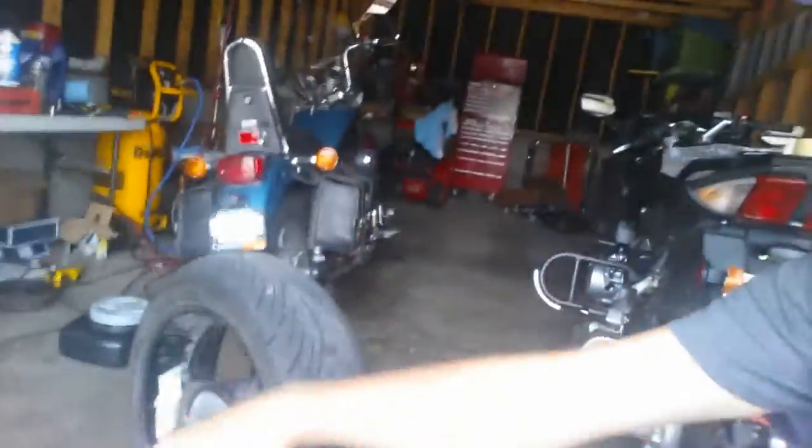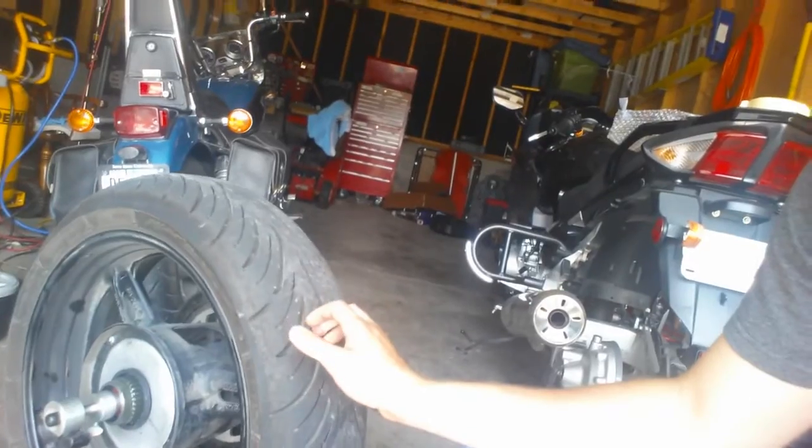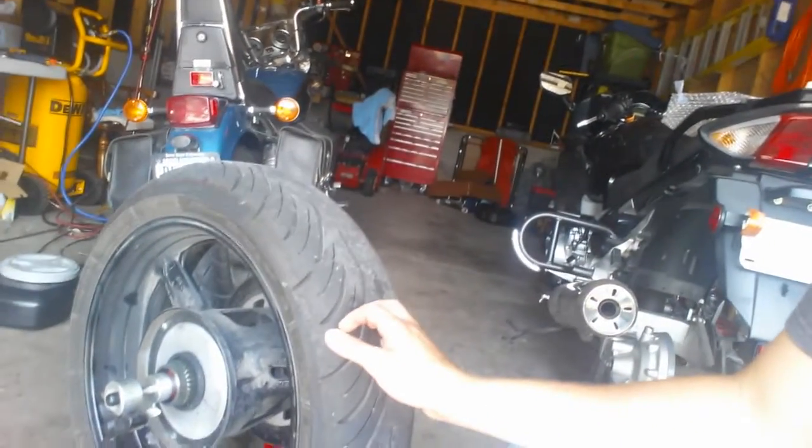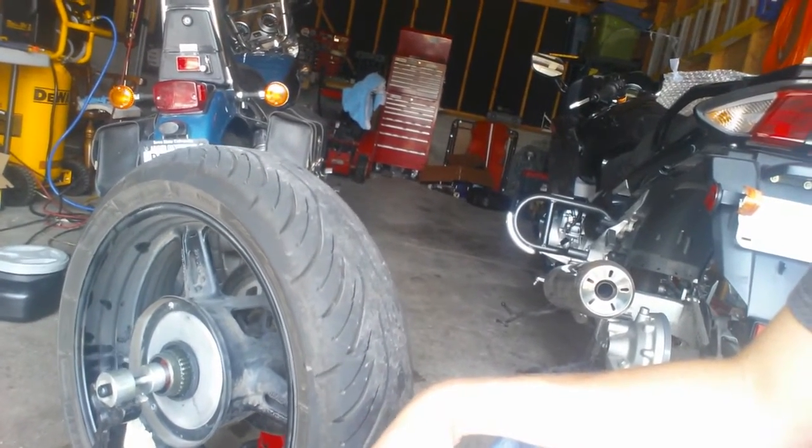What I've got here is the rear wheel pulled off of my FJR, and I've got it on a balancer that I'm going to show you in more detail in just a sec. I'm going to go through the steps of balancing your own motorcycle tire. The first step is going to be to clean the wheel, because as you can see there is a lot of dirt on it. I'm going to take the wheel off the balancer and clean it up. You can use a specific wheel cleaner, a little bit of rubbing alcohol, or maybe some brake clean — but don't get that on the rubber of the tire. Just get the wheel nice and clean. I'll be back after I do that.